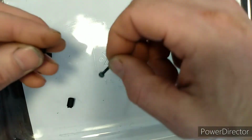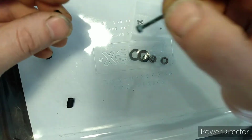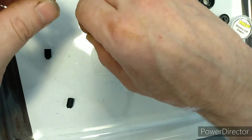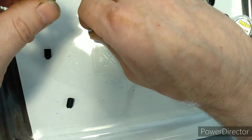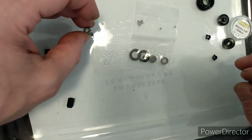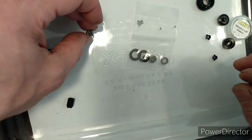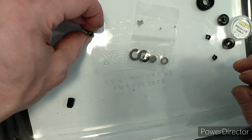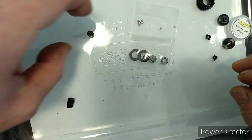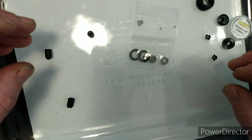They all look the same. Okay, so I'm going to put the thrust assembly into the outdrive cup. I'm guessing I'm going to stand the screw up like that and slide this down over it, and try not to knock any bearings off. And then I'll just leave that sit, I guess.